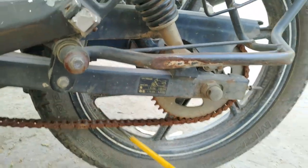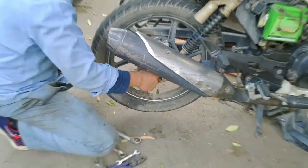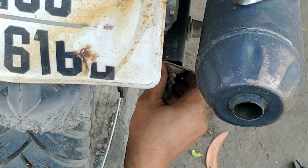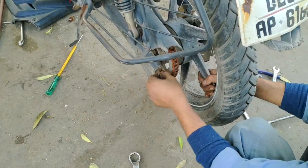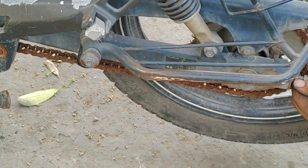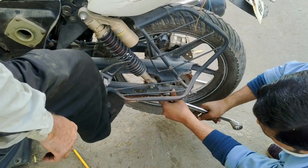Before the lubrication process, the chain is very loose. This is the first day when I cleaned up the carburetor and petrol tank — that was another job done with my mechanic. The swing arm is back here, and because of that the chain adjustment is a tedious process. Depending on your preference — tight or loose — you adjust to the level you need. Now it's almost tight, as you can see. It was super super loose before, and now it's tight just for this purpose.